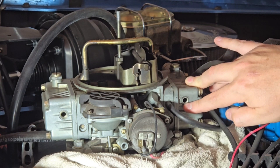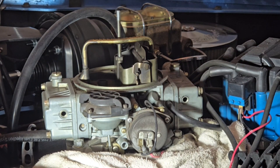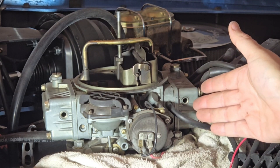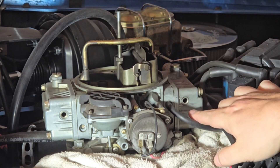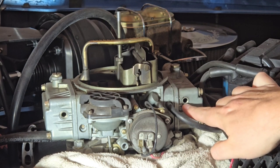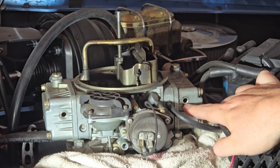If you don't see any fuel at all, then you need to raise your float. Now if you have a manual fuel pump like I have, you're going to want to turn it over. That'll start pumping fuel into this area. Once again, if it starts to come out, then it's too high. If it's just barely dribbling, then that's okay — it's right at the top level. And if nothing's coming out at all, it means you need to raise it.